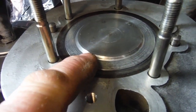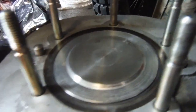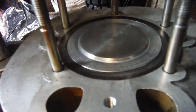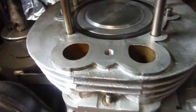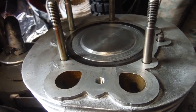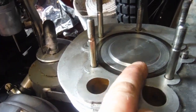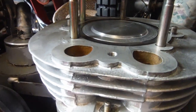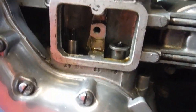The reason I didn't machine right across and make it flat again is that I also wanted to increase the compression ratio. What I've got there actually increases the compression ratio from the original 8.5 to 1 up to around 9.2 to 1. So the purpose is dual fold — I've got a nice squish area reinstated and I've increased the compression ratio by shortening the barrel and modifying the piston crown.